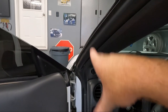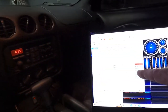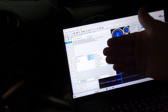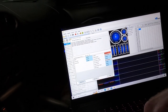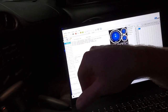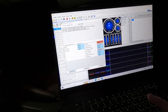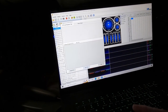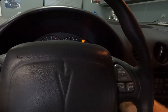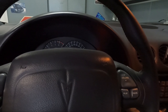We also have a P1415, which is secondary air injection system bank 1. It's all based on that air injection — there's a motor that goes under the driver's side fender in the very front. You guys have seen me take it out on the channel — the red Trans Am, the white convertible recently — and I also took the EGR off and put headers on the Trans Am. Either way, I'm going to clear these out. They're going to immediately come back, but I cleared them, and so now when we start it our service engine light is off. However it's going to come back.